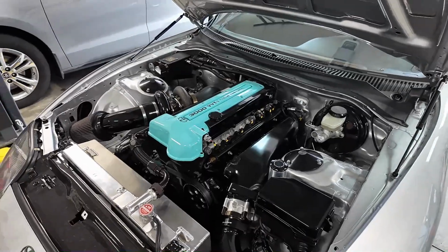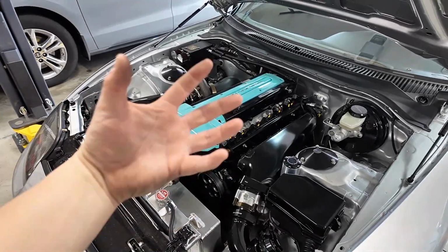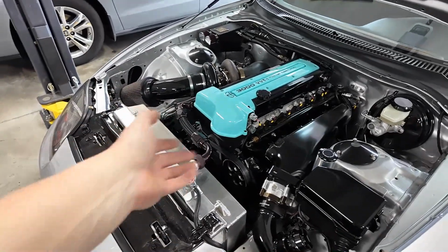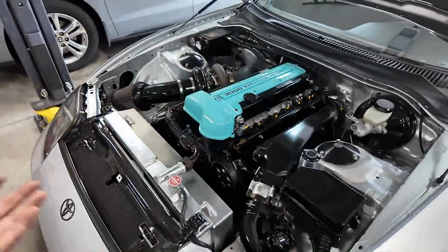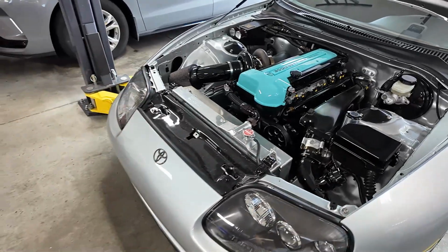But again, till you really drive it, that's when you would notice it, get some real line pressure going through the thing. Although you shouldn't be seeing a ton of pressure on the backside of that seal. It's kind of like a splash guard more than anything. It's kind of like a front and rear main seal. Usually when those seals fail, it's because you have another underlying issue somewhere. But I just wanted to talk about that real quick.